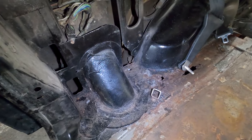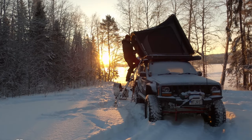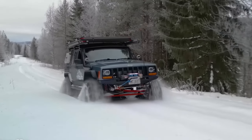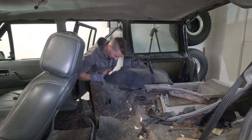You might think your door seals are good and there's no way water's getting in - I'm telling you now there is always a way for water to get in, and you never know what history that vehicle has had. Even just getting in a vehicle with snow on your boots for a whole winter will put inches of water underneath that carpet, because it soaks through the foam, gets trapped underneath. You've just got to get that carpet out and figure out what you're dealing with.